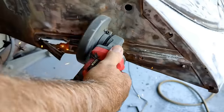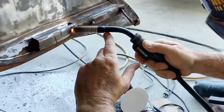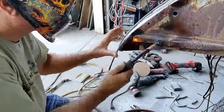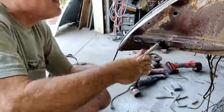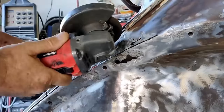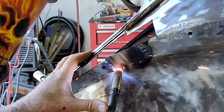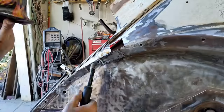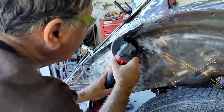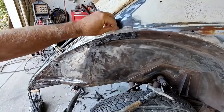At the back, when I welded it I didn't have it up on the lift and I actually missed a spot — I didn't get good penetration on the weld. The problem with welding is just being able to see, and I'm older so my eyes aren't the greatest. I missed the spot where I was supposed to have the torch. It happens a lot — you have to get both sides of the metal. You can't just get one; you've got to melt both pieces for good penetration, which is kind of hard when you can't see as well.